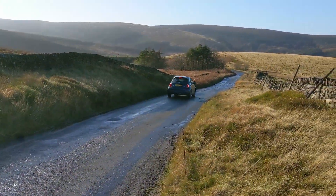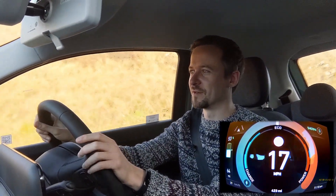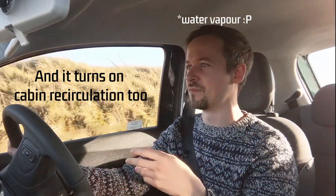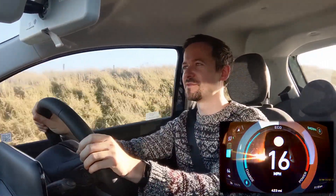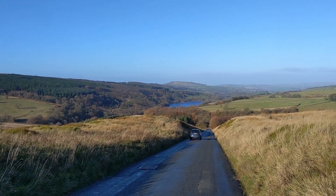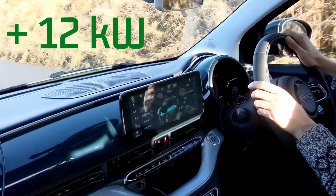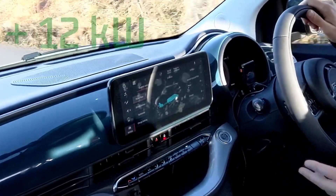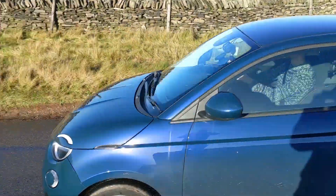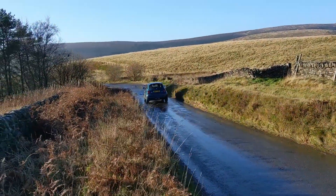You're basically getting free fuel as you go down the hill. Of course, at some point you probably have to go back up — what goes down must come up again. One issue with Sherpa mode is that the car tends to steam up a bit because there's no climate control to remove moisture from your breath. We're coming to the steepest part now — this valley descends 150 meters in just one mile. I can see I've got a significant amount of regeneration on the screen: I'm gaining 12 kilowatts of energy, which is enough at this moment to power 120 mid-sized laptops or 80 fridges. The car isn't using its brakes at all, so brake pads and discs aren't getting any use — I think I could do an absolute ton of miles in a car like this without ever replacing the brake pads.